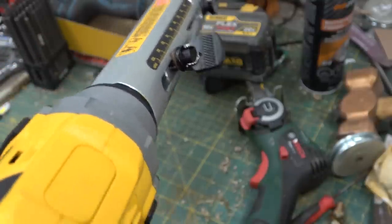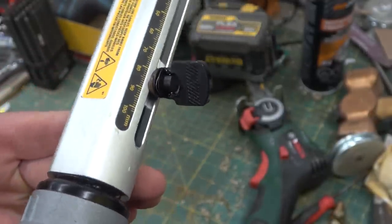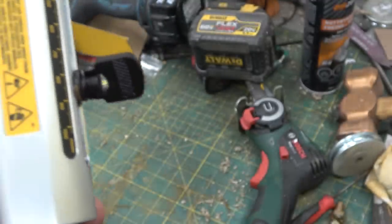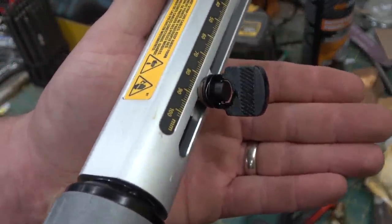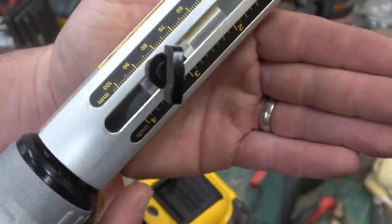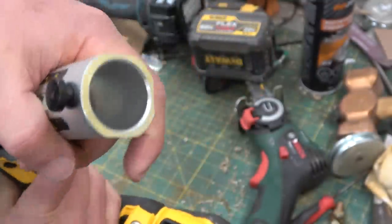Ow, my back. Look at this — a pre-extruded o-ring. That'll be used just for, I don't know, preload. Well, there is a wave spring in there, so I don't know what that's for. Appears to be a Viton o-ring in there, pre-extruded for her pleasure — mangled right up. Whoever put that together didn't give two fucks.